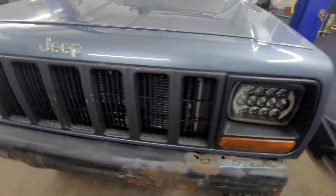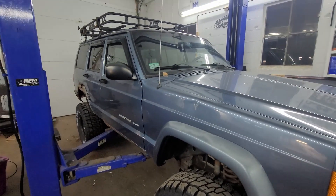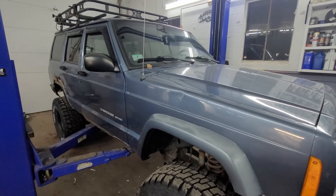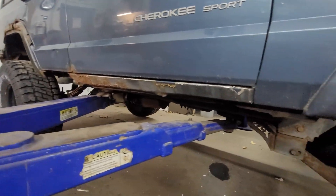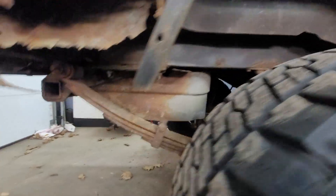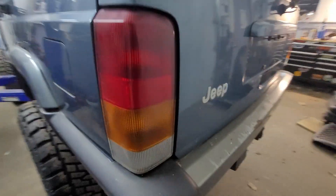The purpose of this video and the coming videos is to show a quick and dirty restoration on this old Jeep. It has 183,000 or 186,000 miles, which is on the lower spectrum for these — it's 25 years old and people rack up miles on them. We've got a rocker panel that needs replacing, some quarter panel work, rear wheel well work, and the unibody frame in there looks okay with just a little surface rust. The rear bumper could use some cleanup too.